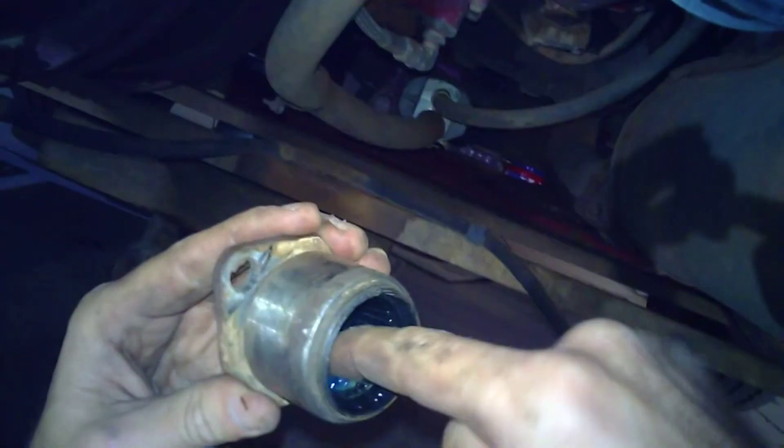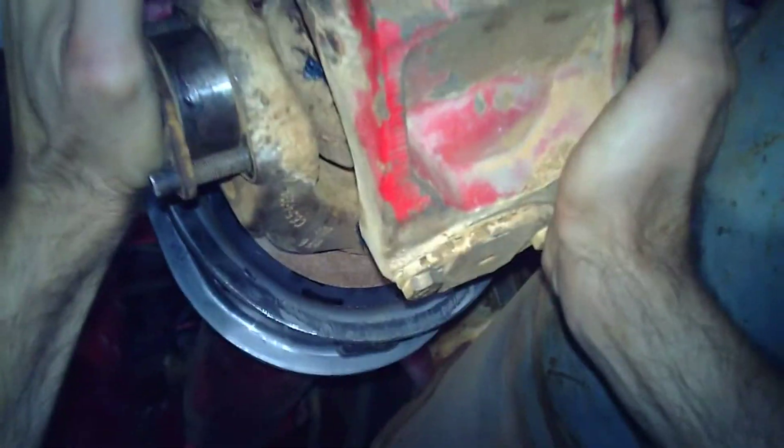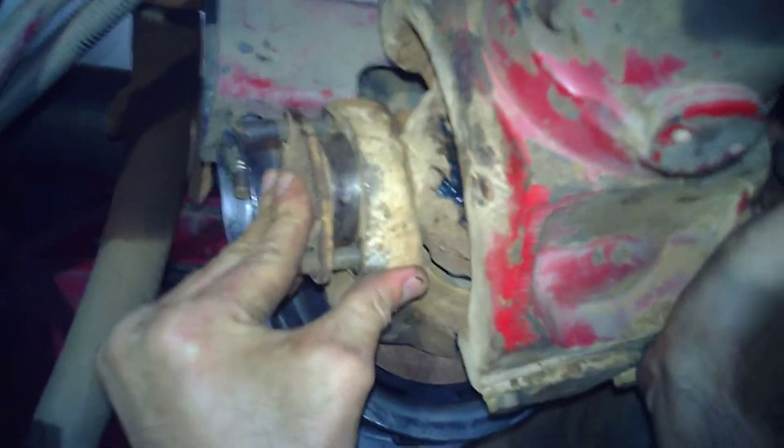Put a little extra grease in the cap to keep the rollers in place. Fit the cap taking care to make sure the rollers stay in place. Push the unijoint cross shaft so that it sits up into the cap as you are pushing the cap into the yoke. Wiggle the driveshaft up and down, back and forwards as you wiggle and push, and at the end you will have to tap the cap just to get it all the way home. Having the cross shaft inside the cap prevents the rollers from falling down when you are tapping or pushing the cap in.